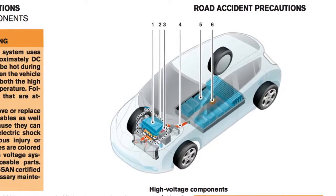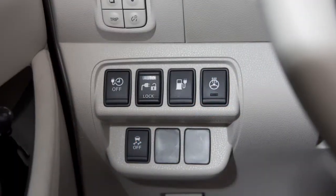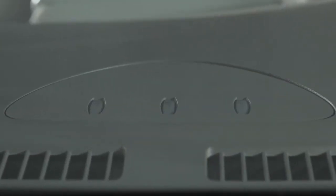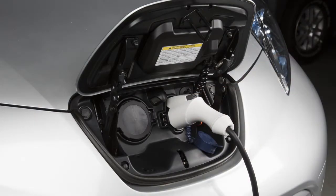If you would like to charge the lithium-ion battery without waiting for the preset timer, push the immediate charge switch while the power switch is in the off position. When the charging status indicator light displays the immediate charge mode, connect either the normal or trickle charge cable to the vehicle. The immediate charge will be available for 15 minutes before returning to the previous setting.